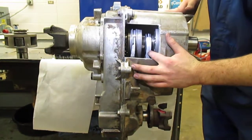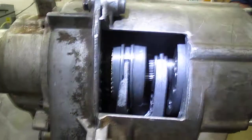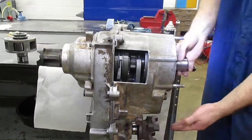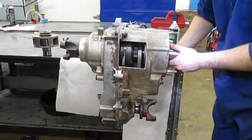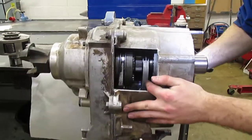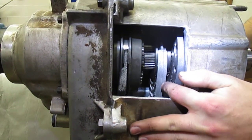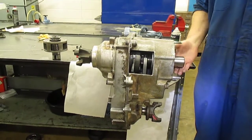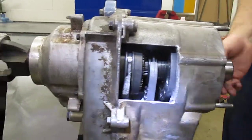Right here, like I said, this is our range. Right now we're in two-high again, and that's because this is flowing freely. If we go into four-high you can see how all three will move with each other — they're all connected. And if we go into neutral you'll see that this range-selecting fork will move up just a little bit. That provides a neutral — you can see because I can move the input shaft and none of the output shafts are moving. Donovan has a planetary gear set over here and will explain that a little bit better.